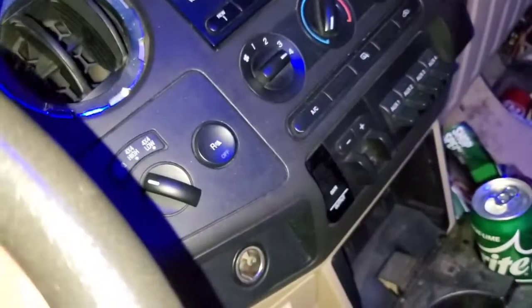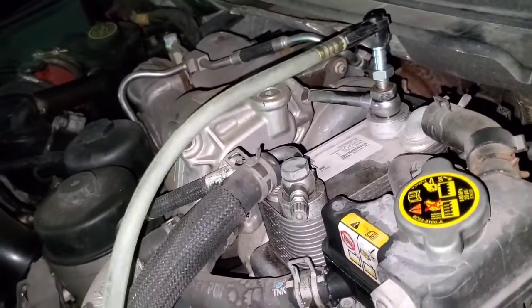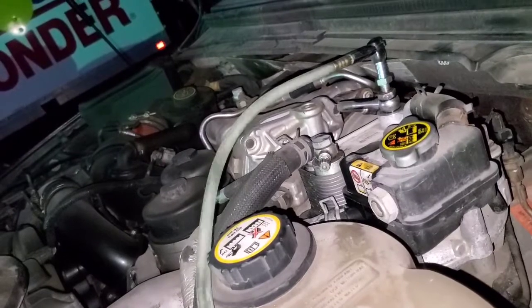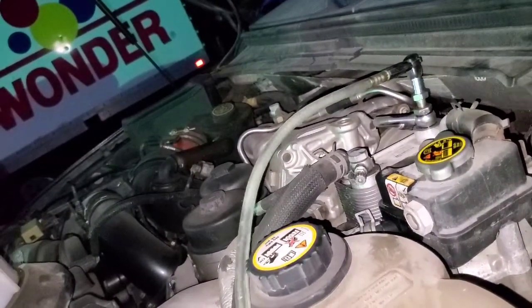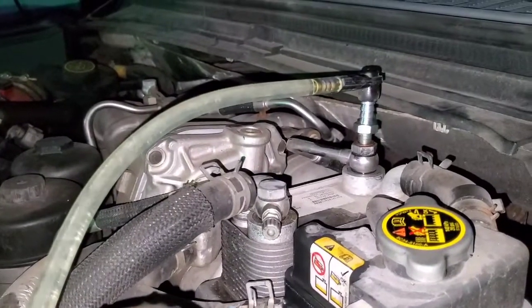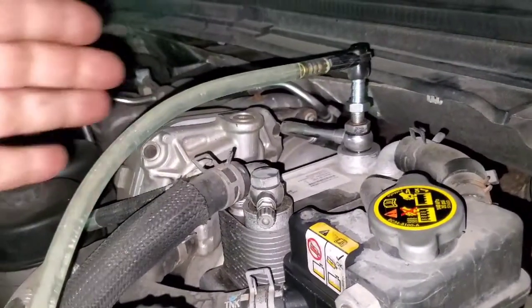All right, we're inside, we got our key on — blinker's on too. Key's on. Got a lot of air in there. When the flow turns solid, that's when we're good. So we're just going to keep going until it turns solid. It's supposed to be about 30-second intervals. When you see that lift pump kick off, turn the key off and do it again until we're solid. Now we're getting solid — look at that. That's solid, technically.